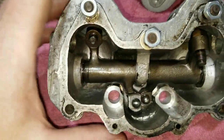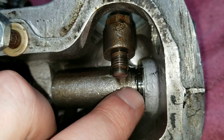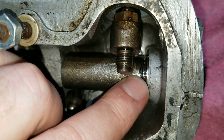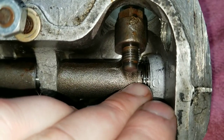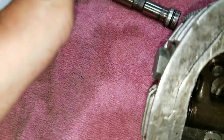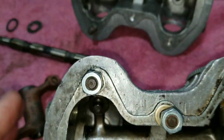On this rocker box that came off the bike, it's set up wrong. You can see the Thackeray or spring washer is blocking the oiling groove when its tail goes into the slotted area, and the flat washers are on the outside. Whether this was ever apart and put back together wrong, or if this is original from the factory and was set up wrong in 1971 to begin with, it'll just heat up and discolor because oil isn't flowing properly.